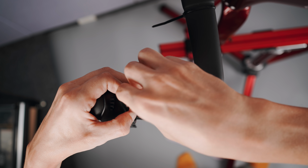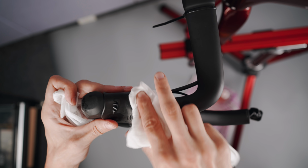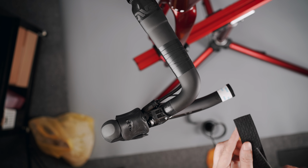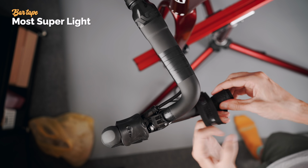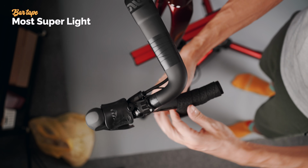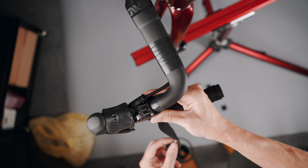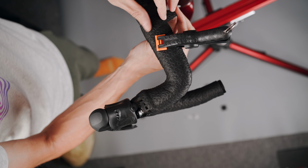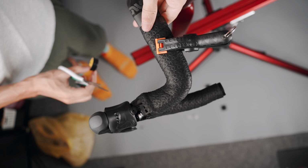With the bleed done, the cockpit is nearing completion. Securing the hose and the Di2 cable is super simple with the grooves on the underside of these Enve AR bars. And the only thing worth mentioning regarding the handlebar wrap is the start when you have the Di2 junction box. I use double-sided tape to keep the junction in place, as well as the bar tape, and then begin the tape by cutting it diagonally, just the same way as I end it at the top. There's not much more to it really. Super simple to finish the tape on these bars with a very clear section on where the wrap should end.